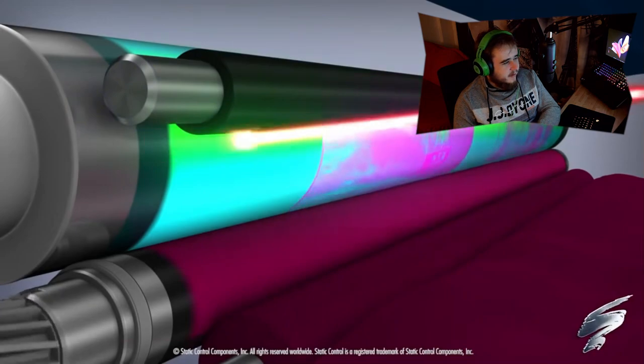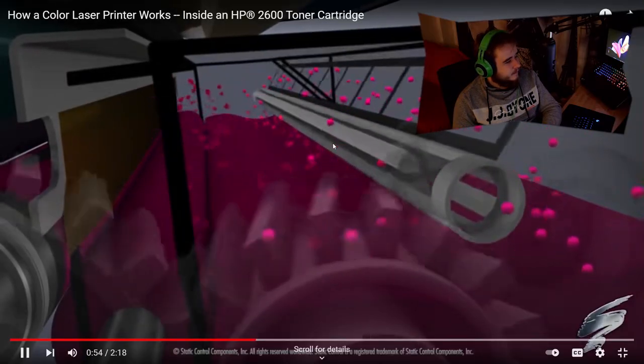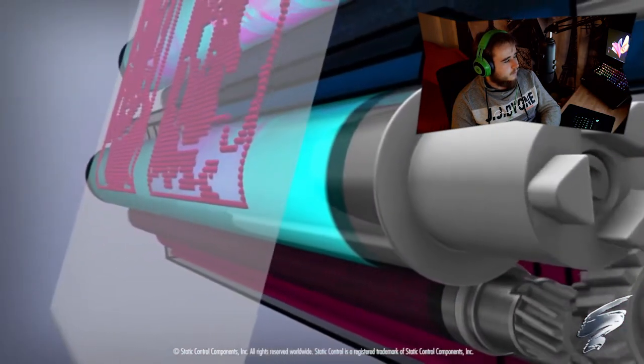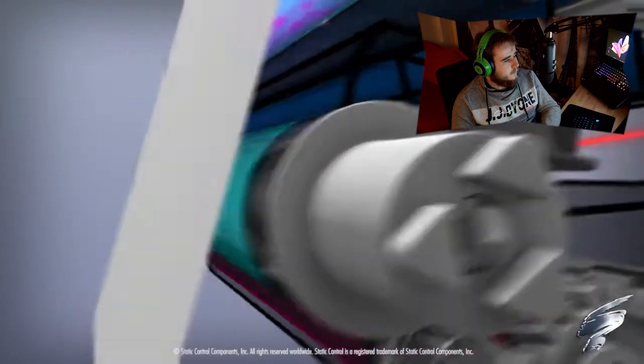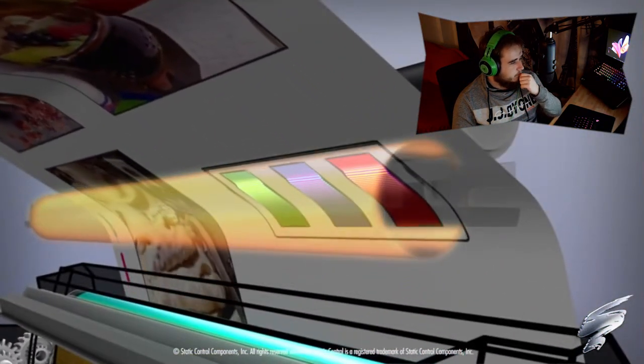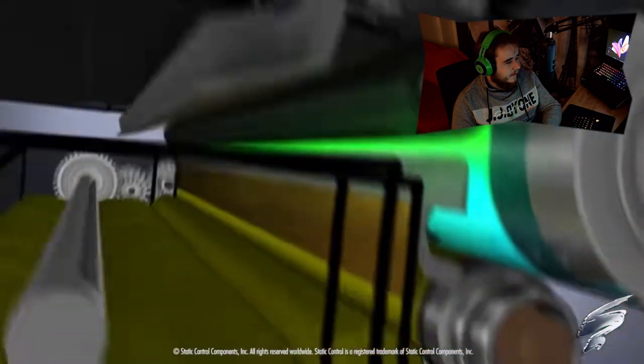It's the same concept. I imagine it's the same for every color, and then they just get mixed together on the paper. Looks like a chipmunk. The toner on the OPC drum is then transferred to the paper. This process occurs within the four color cartridges in every laser printer. The paper with the toner then passes through the fusing assembly, where it is melted and fused to the paper. It just happens in every one of the colors. So yeah, it's a really similar process.